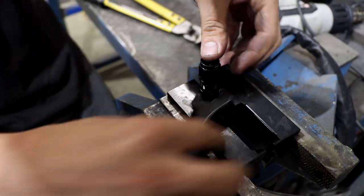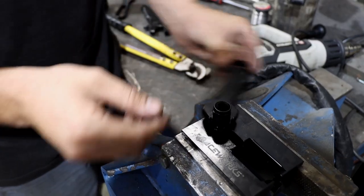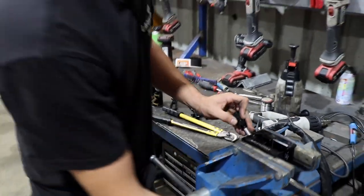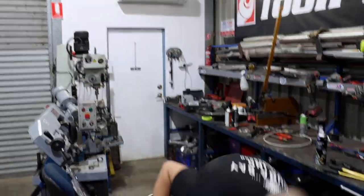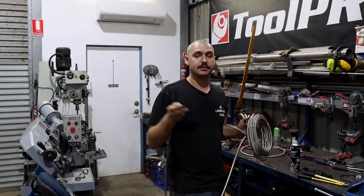And then your AN spanner so you don't scratch the fitting. And they don't have to be overly tight once you get them down. That'll be about it. Don't have to go reefing on it. So that's our line now that's going to run back to the fuel tank, up to the fuel rails into a T-piece where we split off into two dash sixes.